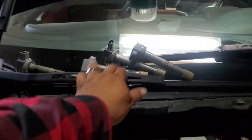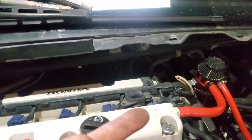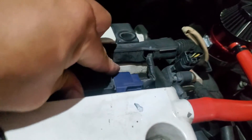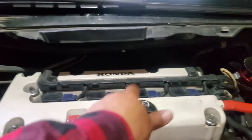Make sure they're nice and snug. Then we're going to insert the coil packs — one, two, three, and four. Start with the fourth one, and that would be a perfect time to go ahead and connect that pigtail just like so. Go ahead and press it down, and do the same to the rest. And there it is — let's go ahead and secure each one now.